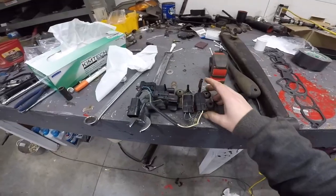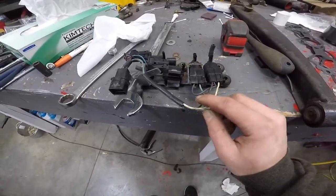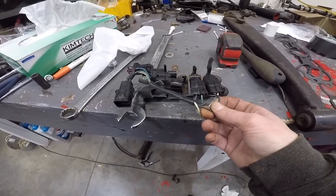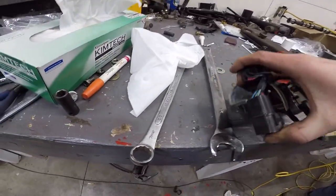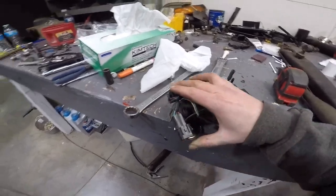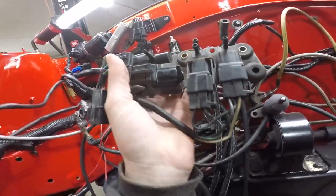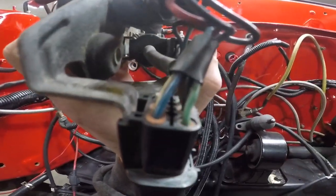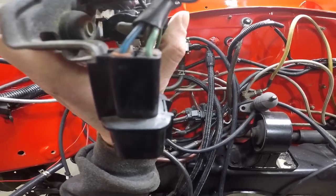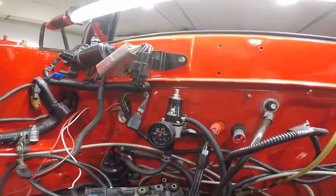Alright, here's the bracket - this is your boost solenoid, boost controller, whatever you want to call it, OEM. It's going to be this white and this black. The black is probably just a ground - I'm probably already tied into that somewhere. This white one is a signal wire. You can see it comes all the way over and it's the second one in. So if we plug this in, it should be the second one in on the back bank. If you change these wires, it's that black and that white - you come up and over, second ones in: green and blue. So it'll be the second ones in once you plug it into the car, and polarity doesn't matter.